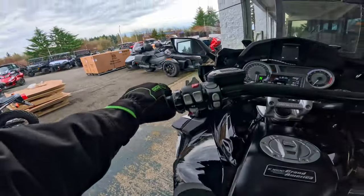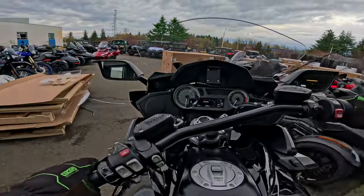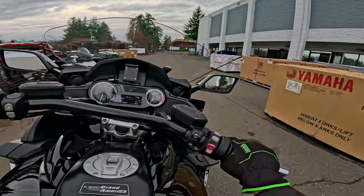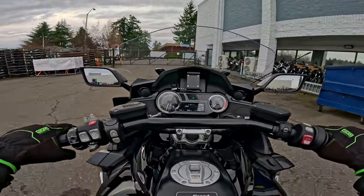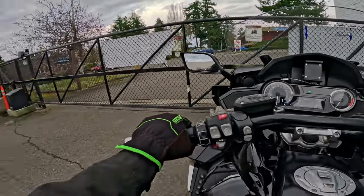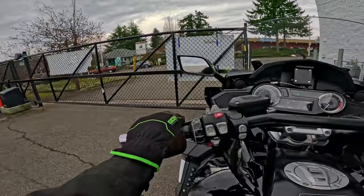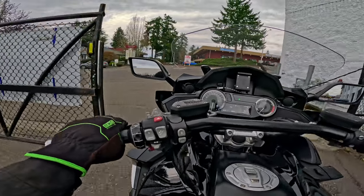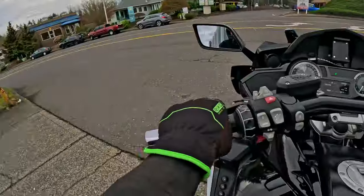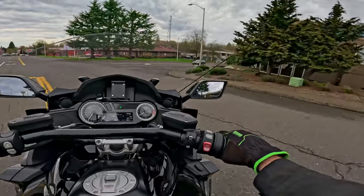Let's take this old land yacht for a quick little rip. I always check tire pressures on anything that comes through — not having anybody I've laid a hand on roll out with low tires or worse, grossly overfilled tires. It wasn't bad — seven and a half low in the front and about six low in the rear. It should have been throwing some codes for that. I didn't ride it before because it was just in for the no-reverse issue.